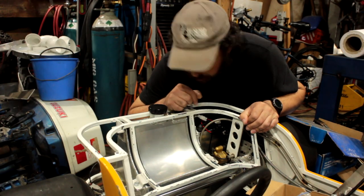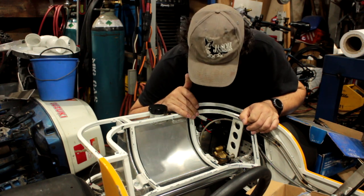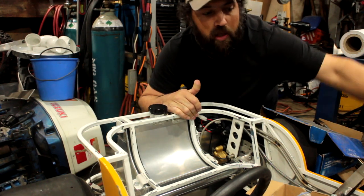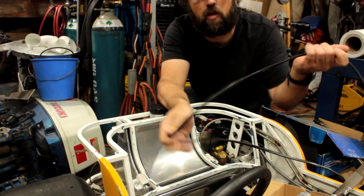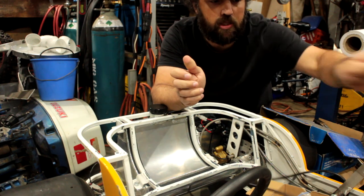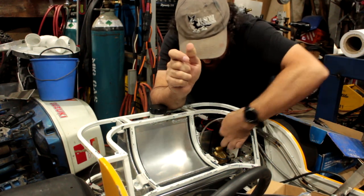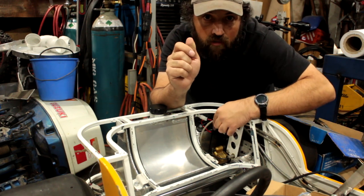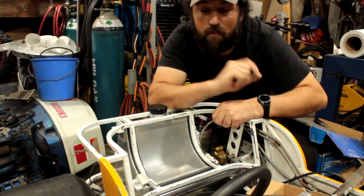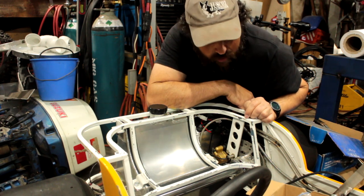The engine and fuel systems are all plumbed back up at this end, so the next thing is the battery relocation cabling. I've got this 2-core wire with black sheathing so it matches in with the rest of the loom. I've put an eyelet on each end and a large inline fuse holder about this far from the battery terminal, so now I just need to find another big blade fuse for that.